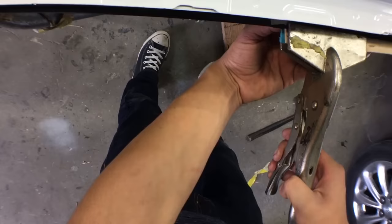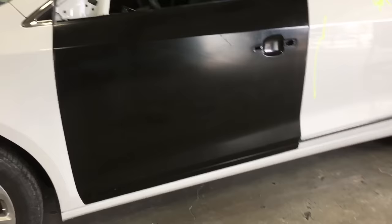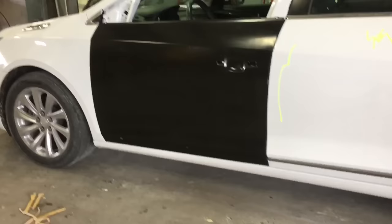On the upper part where it's hard to access, I just bent the top of the lip a little bit, then got my duck pliers and smushed it all the way down. I cleaned any leftover panel bonding with some thinner. Then I pre-fitted the door, made sure everything lined up and squared up evenly, and sent it off to the painter. Thanks for sticking around — don't forget to rate, comment, and subscribe, and I'll see you guys around.